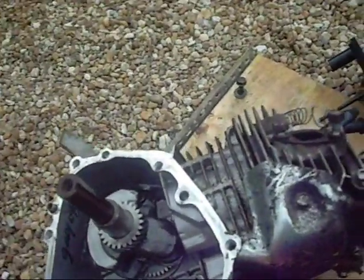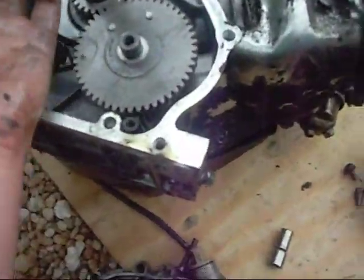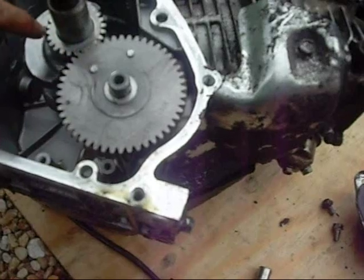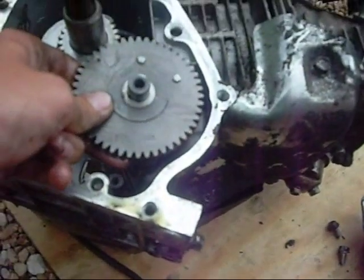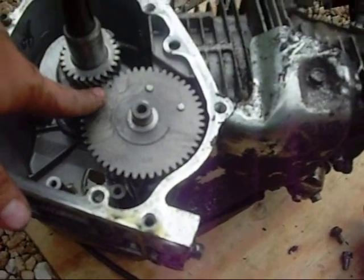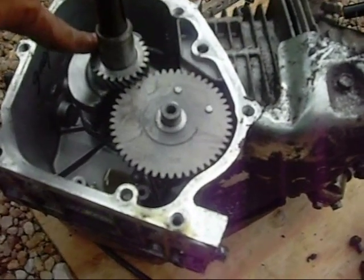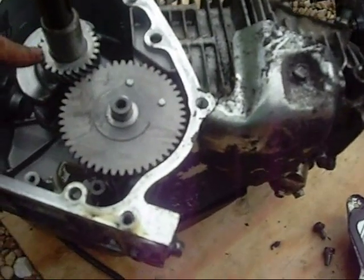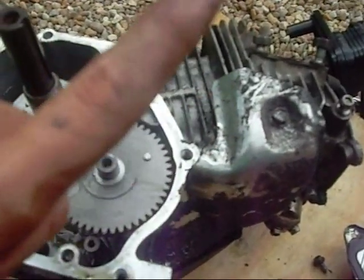When you're doing the timing, remember I said about how you have to have the little dots line up? Well, there's two parts to that. Because this is a four-stroke engine, the crankshaft spins around two times for every one time the cam gear does, because it's a much bigger gear. The entire cycle goes around twice and it only fires once. So: piston comes up, intake valve opens, goes down, goes up again, fires, goes down, exhaust valve opens, and does it again.